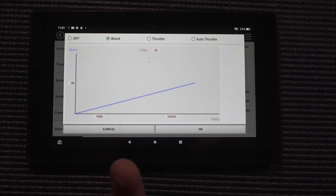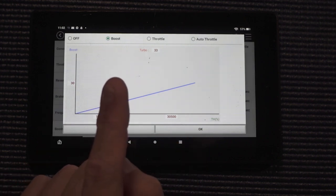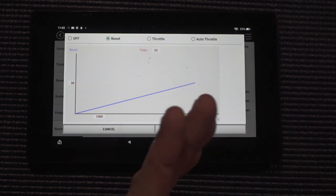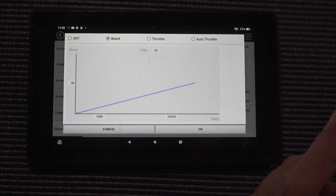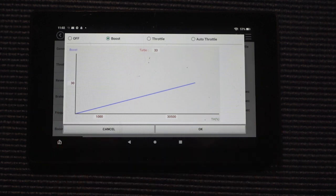You need to know where all this stuff is happening, so data log your runs. If you want to calculate all this, factor in your ramp, your curve, your start power — all that we've already talked about. There's not going to be a set number, and you don't want to take this all the way to 60,000 RPMs because then you're never going to hit your actual turbo. I believe the boost is basically only going to work in this RPM range. You want all of your boost timing in before your turbo timing starts. Unless you don't want to run any turbo — then you could do 1,000 to 60,000 RPMs and put like 40 degrees in there and just try that way.